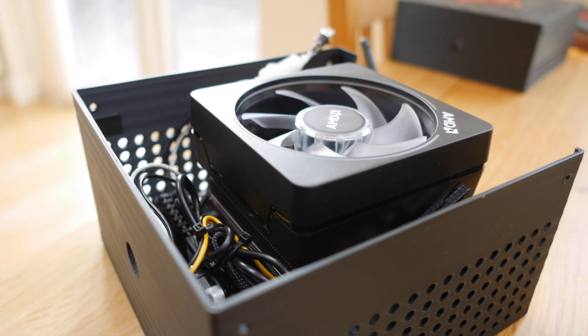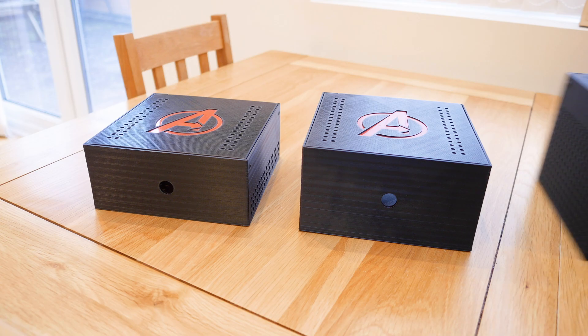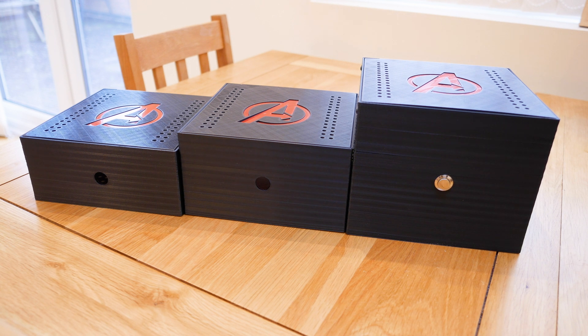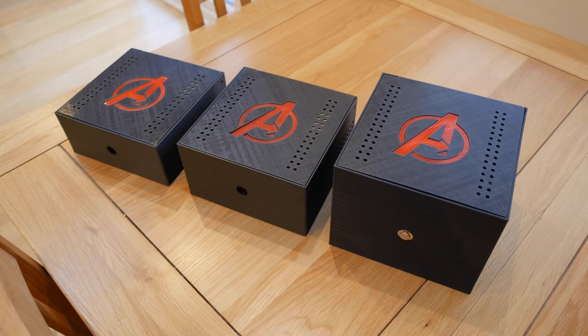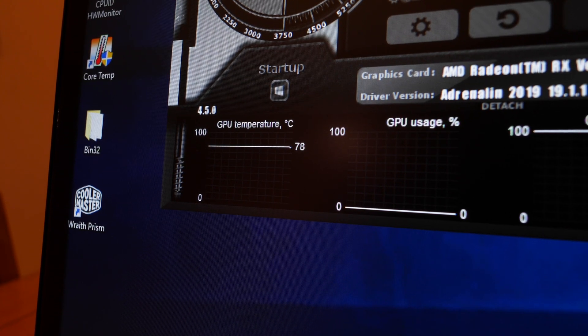Unfortunately, it's now too tall to fit in case version 2. At this point I'm thinking, if I have to print another one of these things I'm going to make sure the APU has the best possible chance of staying reasonably cool. So I printed this monster. It's now 15cm high — 50% taller than version 2 and almost twice the height of the original. There should be decent enough space for the cooler to breathe, and a whole bunch more extra ventilation to keep the air moving through the case. So with bated breath I re-ran the tests, and finally temps are under control.